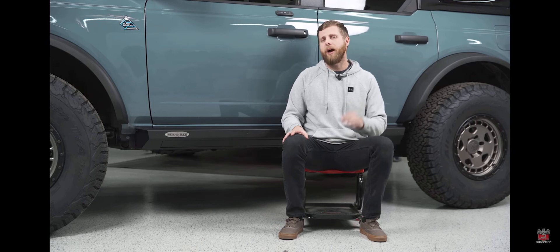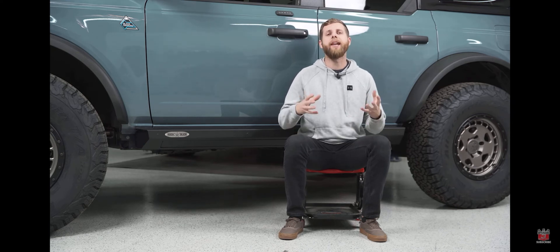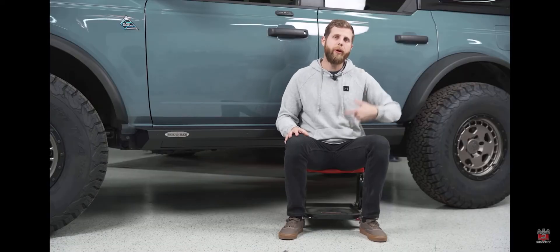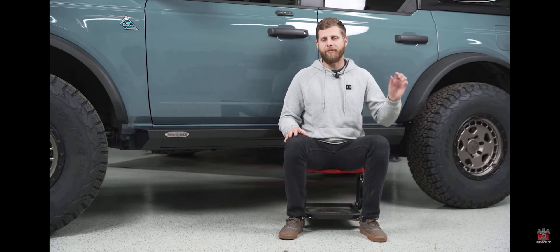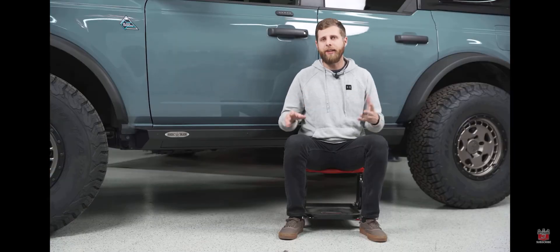Probably my favorite accessory is the door delete kit. Because the Bronco has removable doors, if you pull them off the sensors read as open and the steps stay deployed. The door delete kit fixes this by adding a separate harness tied into the main harness and an additional switch mounted near the base of the seat. This lets you walk up to the truck with the steps closed, push the button to deploy them, get in, and then push the button again to retract them from inside. One small drawback is that the button is only on the driver and passenger side front doors, so rear passengers on a four-door can't independently deploy the steps — but it's not the end of the world.